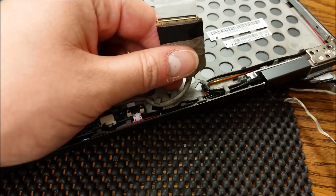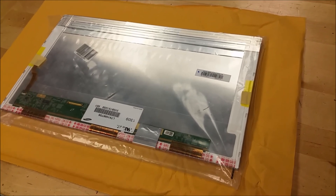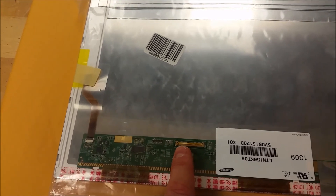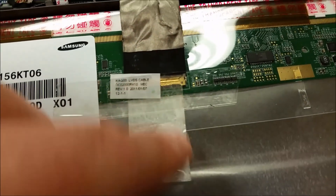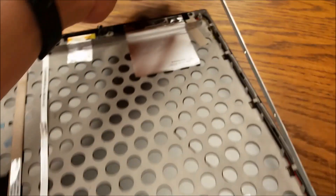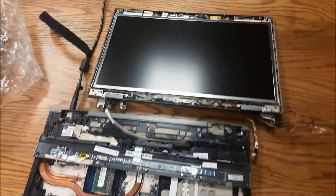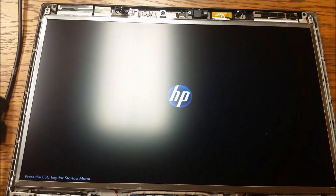Perfect. Now there's your gold connector and we can get out our new screen. Here's our new panel from Laptopscreen.com. It's going to have that same connector, hopefully in the same place as the screen we just removed. All you need to do is press that connector in and you'll hear a slight little click. Take the existing tape and tape it down nice and tight. Now we're going to hook up our hinges again here and try to make this reassembly process pretty quick. Before we screw anything in, let's make sure this screen works. We've got the monitor hooked up to the laptop — look at that, she looks gorgeous.